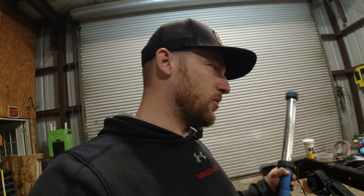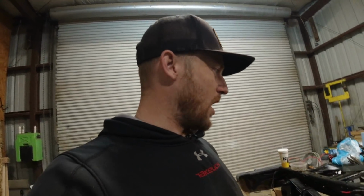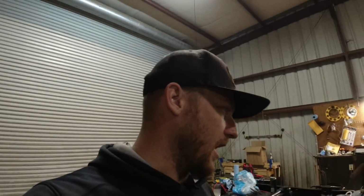Then, from there, I sandblasted it. Use the pressure washer with the sandblaster, you saw that. Then I went through it with wire wheel and buffed it all up. Then I hit it with the spray, which was this stuff here. Show it to you guys one more time. Spray bottle. The rust cutter. That literally took it down to bare metal in spots that had heavy wire action. Like you couldn't see bare metal before, but it took it down, made it nice and shiny.